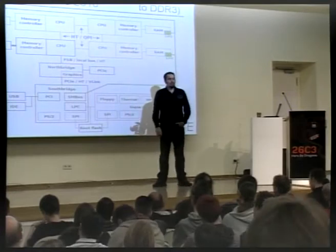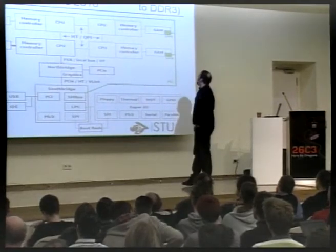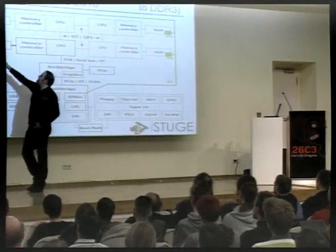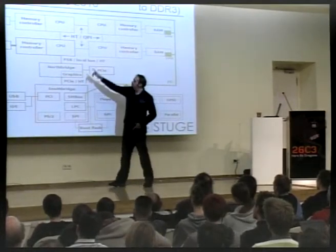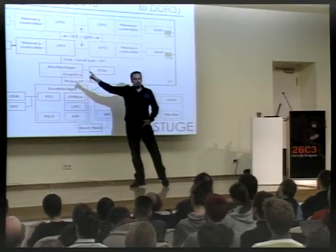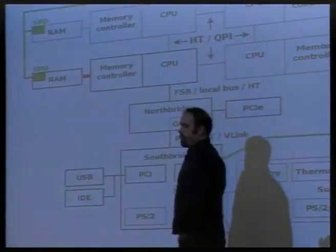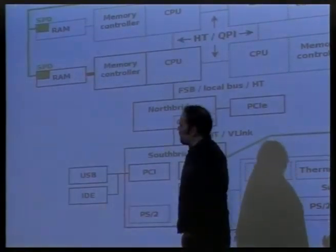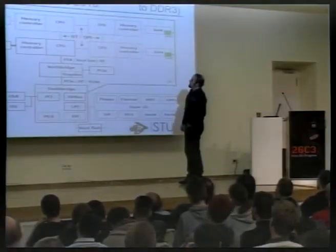All of that configuration at the memory bus is highly dependent on the DIMM. Where's that information stored? It's stored in these little SPD boxes on the DIMM. We're running on the CPU from the boot flash, and we have to go out on this green bus and read the contents of this small EEPROM — the SPD EEPROM — to find out how we're going to program the memory controller so it can drive that particular RAM module on the wide red link.